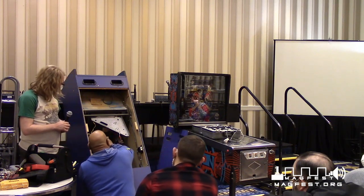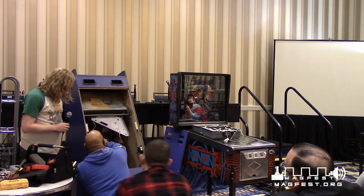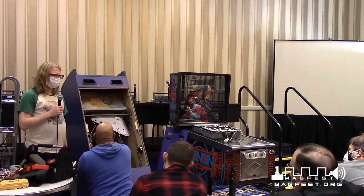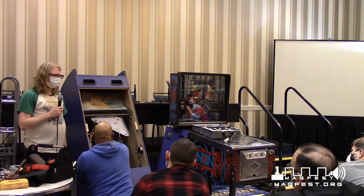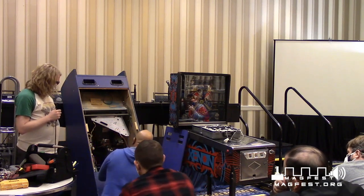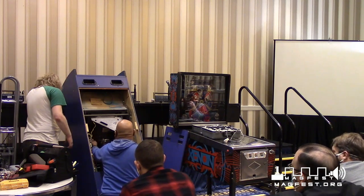All right, so you basically, I don't know if you're gonna see a spark or not. If anybody's looking here, you might see a spark. I'm not sure. Oops, you heard that? Everybody heard that, right? Yep. That's a discharge right there. I usually do it a few times just to get it out of there. Okay, so now the monitor's discharged. I still don't suggest that you touch this with your hands.